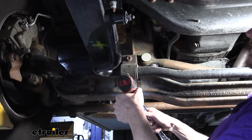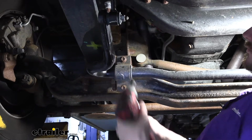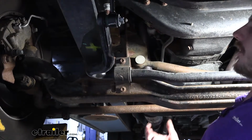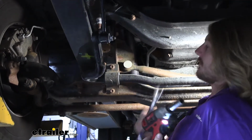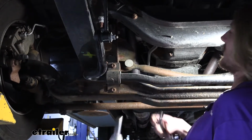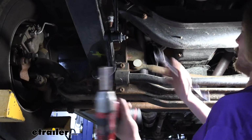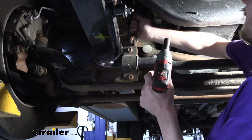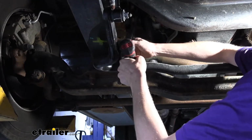And then as soon as you get to the end of the bolt there, we just turned it back in about a turn. That way this can't fall off of here, so we can have a little bit more control with no tools in our hand when we go to pull this thing down. I got both the bolts on the other side already set up like this. This top one, we don't necessarily need to set up since we're getting ready to take it out, but all the ones up to your very last one, I recommend setting up like that so this thing can't fall on you.